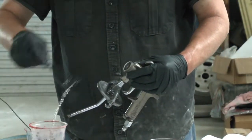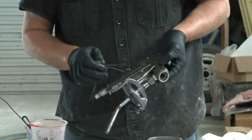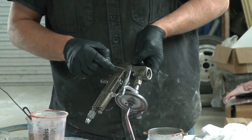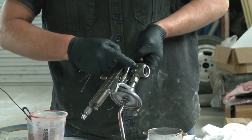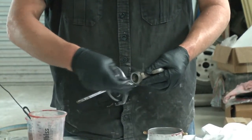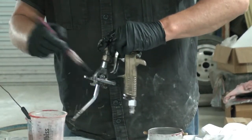Use a slightly fatter brush in from the front and give that a good clean around. Now, another spot where you'll get paint build-up is this little seal area in the front — you've actually got a little bit of casting that's bored through for the needle to run in. Paint will go back to the seal and sit in there and dry. When you start using the spray gun, the needle's going to drag these little bits of paint out and they'll come out in your paint job. So put a little spray gun cleaning brush in through the front and clean that passage out. For the outside of the gun, I just use a one-inch paint brush and give it a good wash off with thinner to brush off any paint that's on there.